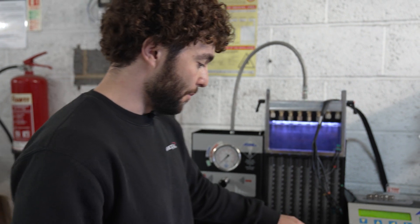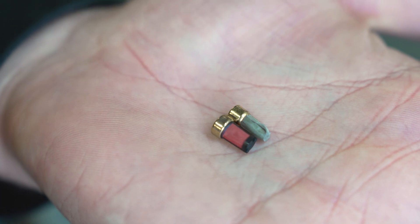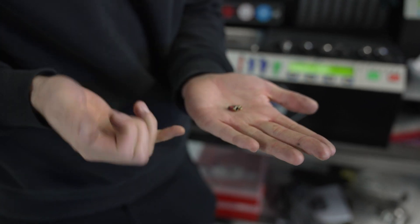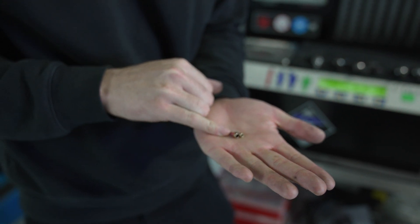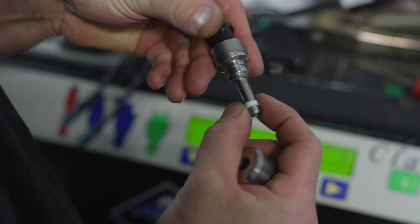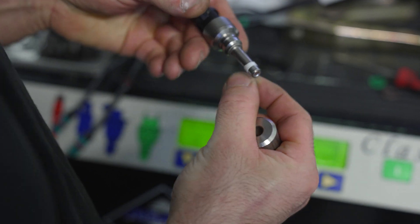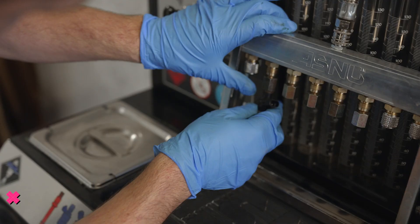At the same time, we upgrade the filter baskets from a plastic item to a stainless steel item, which you can see here. The stainless steel items are much more robust because the red plastic gauze on the factory injectors can basically burst, causing leaky injectors and allowing debris into the injector. We also replace the Teflon seal — the little white ring at the bottom of the injector — as well as the top seal. After this cleaning process, we'll show you what these very dirty injectors look like afterwards.